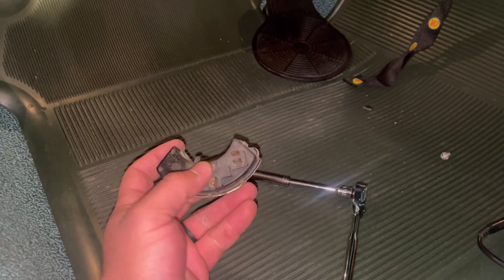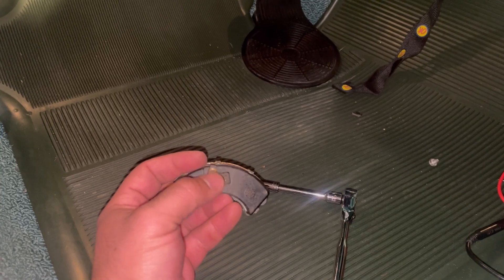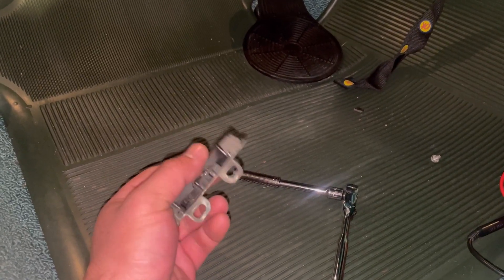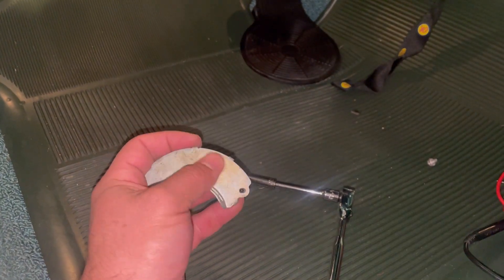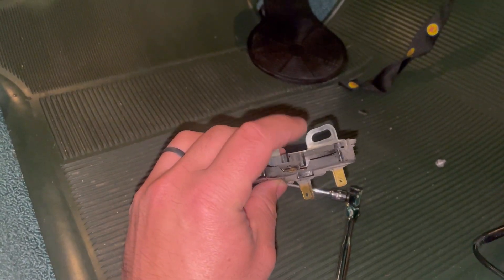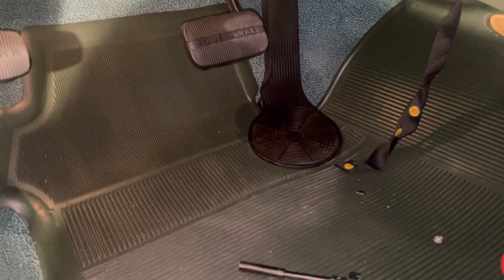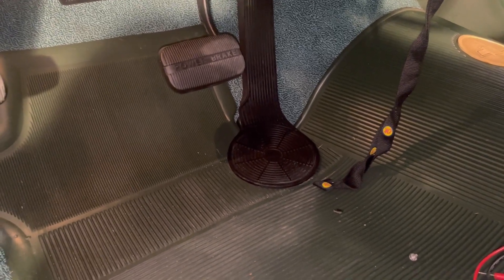Hopefully that'll help someone. If you guys have any questions just ask — I can't say I can answer it but I'll try to help. My biggest fear was that since the prongs for power and reverse lights were in different positions it might change the functionality, but it didn't matter. All that matters is this nub and making sure it's on the slot on the steering column. Hopefully that helped someone — you guys have a good one, thanks for watching.